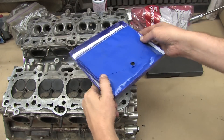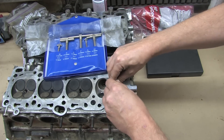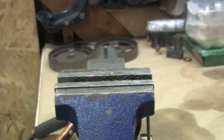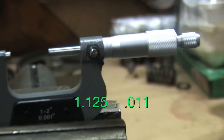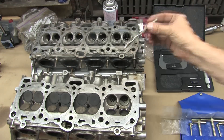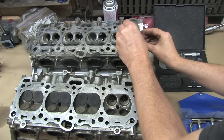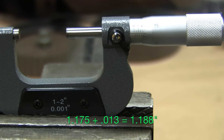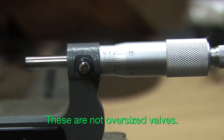For a more precision method, use a set of telescoping gauges — the 3/4 inch to 1/4 inch is adequate for the whole job where the bowls are concerned. It takes a lot of time drawing and documenting your measurements with this method, and you should do it before and after you do the porting work, but it can be done with extreme precision this way. Best use an appropriate micrometer. This example of before and after measurements should give you an idea of the differences between my ported head and the stock head. Here's the seat measurement of the stock intake seat — just to show you how much material has been removed. It's best to bore the seats with precision equipment rather than hand tools because it leaves a better hole.